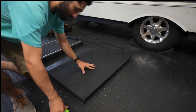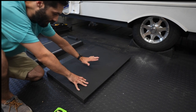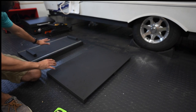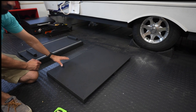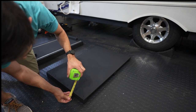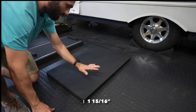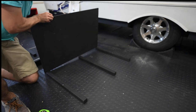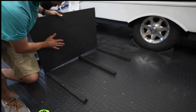Now that we've got everything bed-lined and hopefully relatively water resistant, I want to go over exactly how everything works before I install it because I think it'll be easier to explain. First things first - this is essentially just a platform so that we can raise the bottom of our front storage box up high enough for our slide-out to clear the baggage or cargo door. This is simply to get it up that requisite clearance - just shy of two inches. What I have here are three two by twos to achieve that.